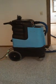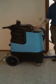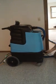The pump actually turns on the pump that goes to your wand or hard surface head that it injects the water. As you do carpet, you don't want to go over 400 psi. This machine can fluctuate between, pretty much takes 200 to force anything out the end of those jets. But you're right around between 200 and 400. You don't have to put it at exactly somewhere in there. That's about the basic between the 200 and 400 psi. It does go up to 1200, and how you adjust it is this knob right here. Turning it right turns it up, turning it left turns it back down.